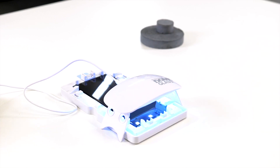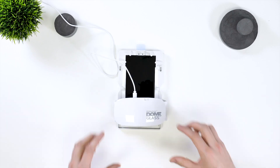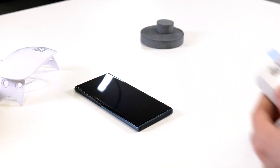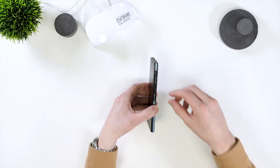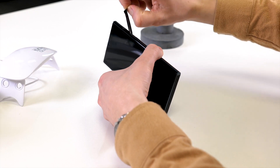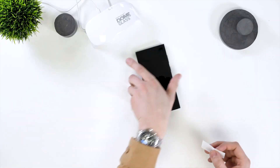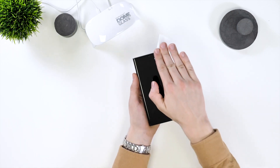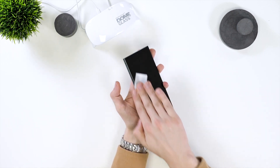Press the button once to set the UV lamp off for 15 seconds. Do this on the bottom, middle and top. Once you're satisfied you can remove the phone from the frame. Now the phone has been removed from the frame — give the phone a wipe down, then you can remove the black protective stickers. Once you've removed the stickers, give the phone a final wipe down to ensure no excess adhesive is on the phone.